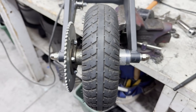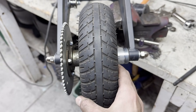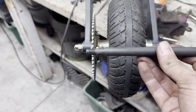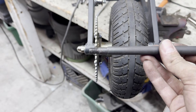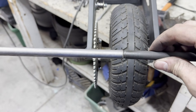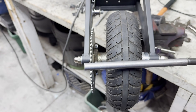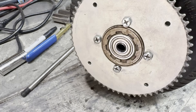I cut the dropouts to make the tire fit and then put the axle in, but that's when I realized this tire's bearings are a larger diameter. I grabbed the E300 axle to compare, and sure enough, it has a larger diameter in the middle. Luckily, I have a perfect tube piece I can grind down and use as a spacer between the wheel bearings and the axle. Just like that, the wheel was good to go. Now it's time to look at the motor.